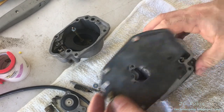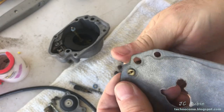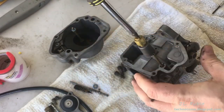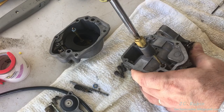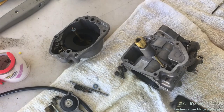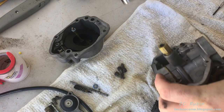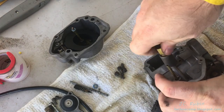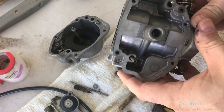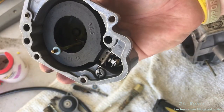This reveals some more pieces. It might be easier to remove the jet to remove the gasket below, so I'm going to do that now. Check the fitment of the screwdriver — yeah, this seems okay. That's a good size for that jet. Turn that out with a half-inch. We can see straight down in there — that's cleared out. There's definitely seen better days but we'll get it fixed up.